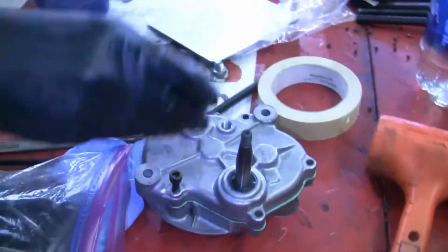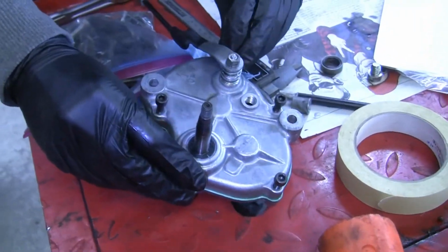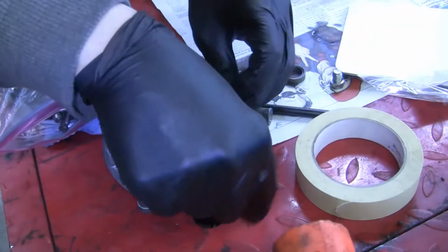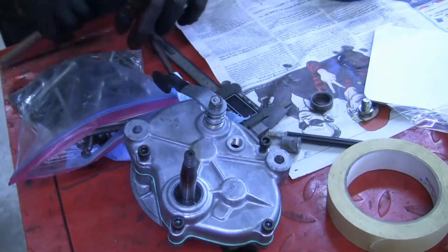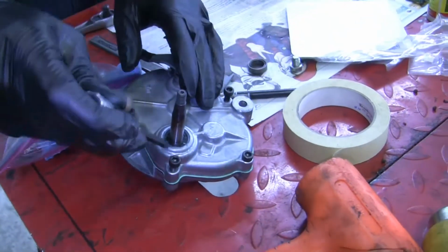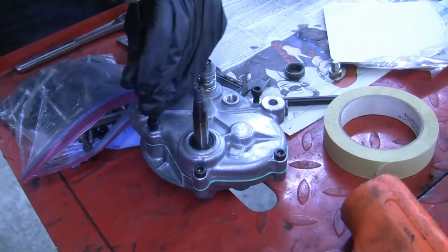there. The two long bolts, typically when you're messing around with cases and they've got alignment pins, the long bolts are always going to go where the alignment pins are. If the original engineers aren't complete assholes, then there'll only be maybe one or two different length bolts. If you get a bike or a car where they designed it so that each bolt was its own specific length by like 5 millimeters difference, that guy was an asshole and I hope he got fired. So if you get a situation like that, you just need to check.